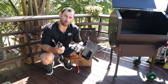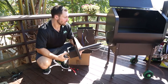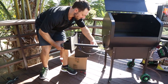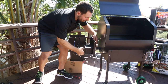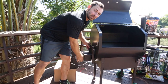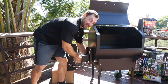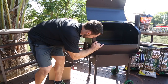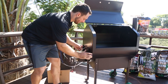If your new auger assembly came with a power cord attached, you'll want to remove that from the plug because we're going to use the existing power cable that came with your grill. Make sure your gasket is in place — that's very important to the operation of the grill. Line your igniter wires up with the hole at the bottom, move your thermal sensor wires off to the side, and check the inside of the grill to line the auger assembly up with the fire pot. If you have trouble getting it that last half inch, it's most likely the igniter wire tubes at the bottom — sometimes using a flat head screwdriver will help line those up. Make sure you haven't bent your thermostat wires.